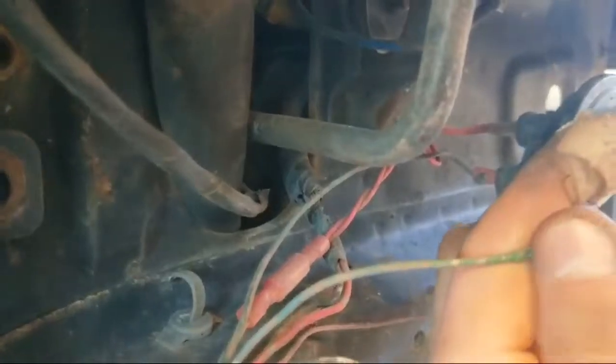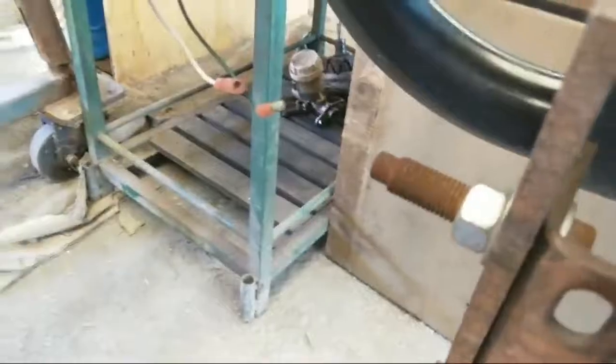So it rubbed through the wire, and then it was just rubbing on there and holding there and breaking the fuse. This bracket was the thing that might have cut it open, or it's where it was rubbing or something, because this edge here was sitting almost right up against this edge here and cutting into the wires, and all the wires just sit there like so.